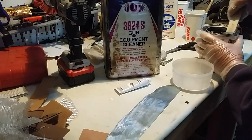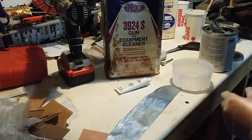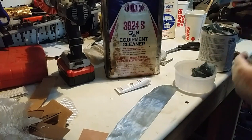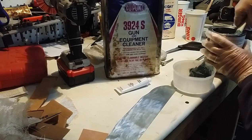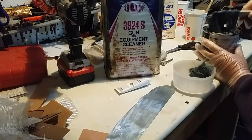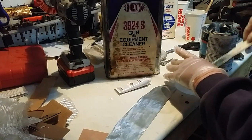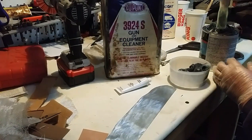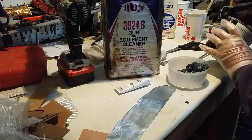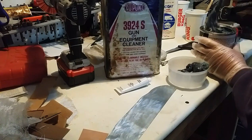So we're going for the Bondo with hair, or the fiberglass reinforced body filler. You can see how it is. It's very structural. And we're going to smear it on this thing. We're going to put it in place, and then we're going to build up the surface with it. It's very difficult to finish with this, like to get a really nice finish. So we use regular Bondo at the point where we want the nice finish, you know, that last 16th of an inch or whatever. Regular Bondo. This looks like a lot. It probably is. Just getting it out of here.